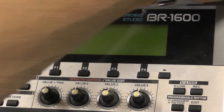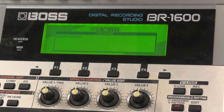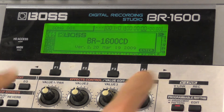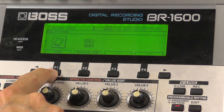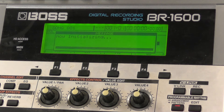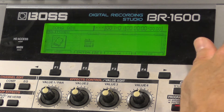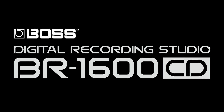Power off the machine and then restart. Now that it's been updated, we can reformat the drive to take advantage of the extra space. Now we have two 40 gig partitions available, which is the maximum you can have on the BR1600. I hope you found the video helpful. If you have any questions, feel free to leave them in the comments. Thanks for watching — I'll see you in the next video.